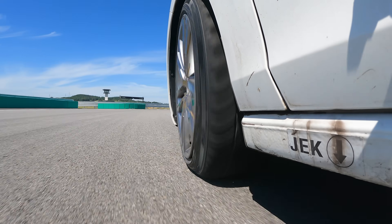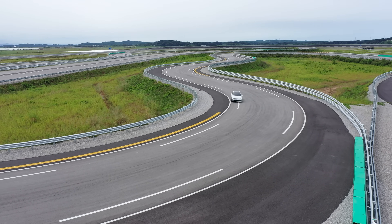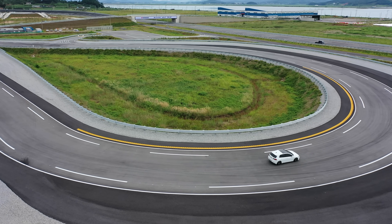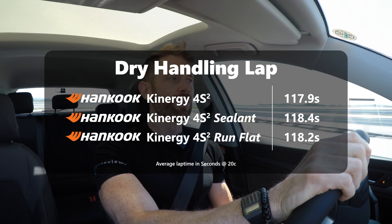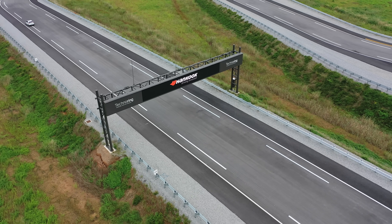What I didn't expect - and this surprised me - is the at-limit communication. Perhaps this is where BMW get their no-run-flat policy for the M cars: the at-limit communication was definitely reduced by a small margin, meaning you had less information about when the tyre was breaking into slip, whether that be understeer or on corner exit when applying the throttle. I just felt more surprised by the fact I started pushing into understeer. As for ultimate grip, over a 1 minute 20 lap they were less than half a second apart - something like 0.25% - which is essentially the same. So in terms of outright grip the run flat technology in the sidewall doesn't give you negative drawbacks or positives either.